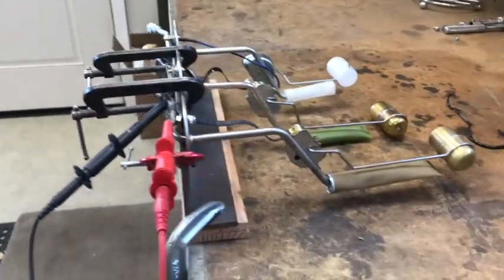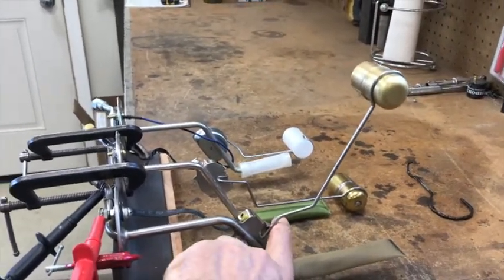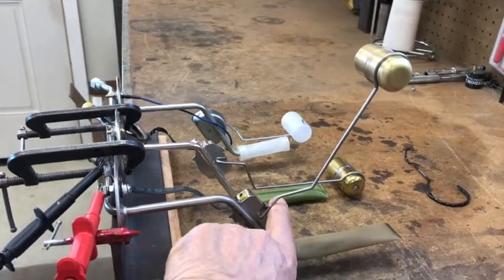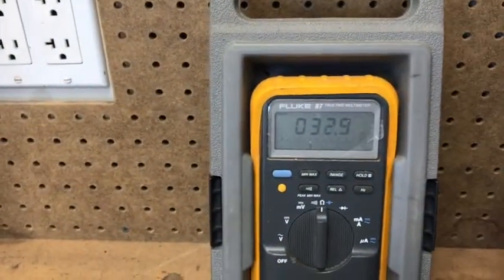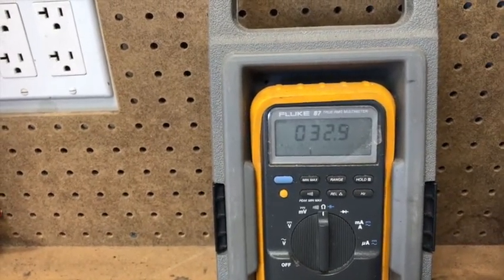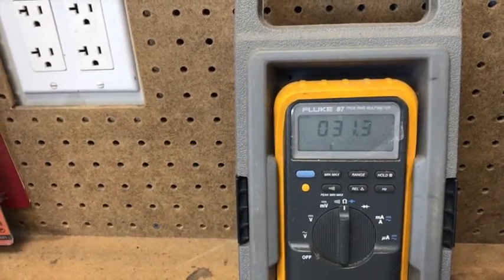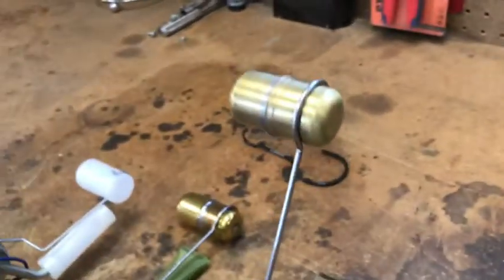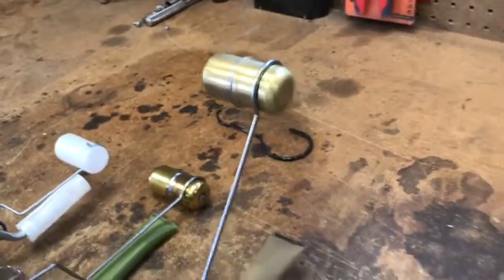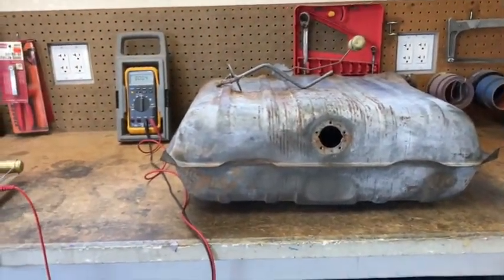The rheostat on these units goes zero to 30. When I pick this up to the limit on the rheostat, it reads roughly 33 ohms — bounces around 32.9 to 33. It's supposed to say 30 with a full tank, which is right there. See, that isn't much lower. This is adjusted in and out of this tank so that when the tank is the way it is now, that's the proper reading. When the tank sits in the car, it looks just like this.